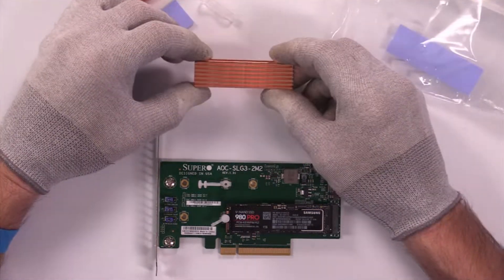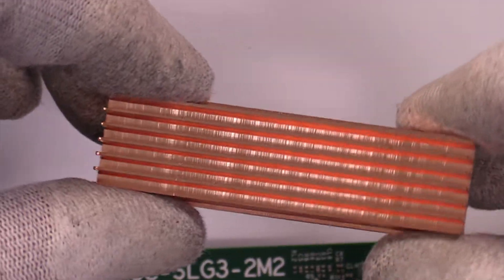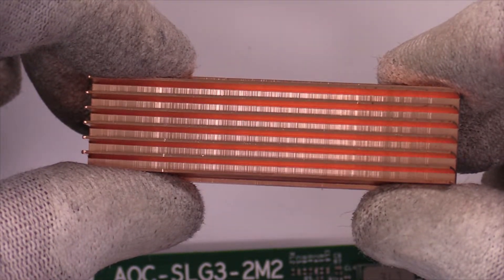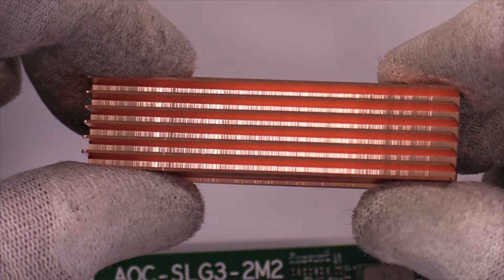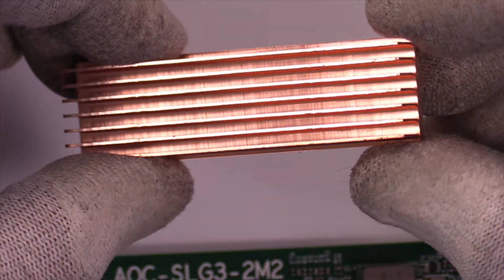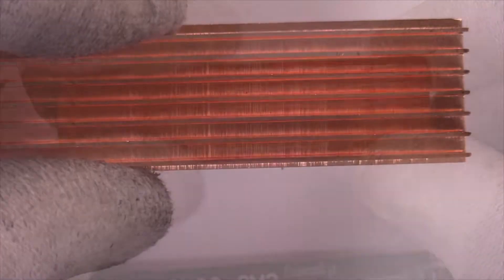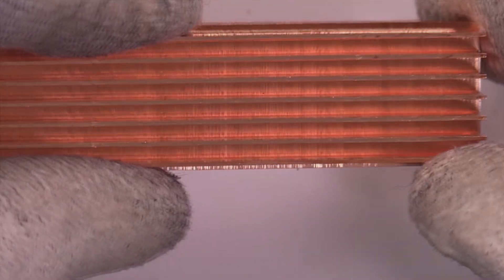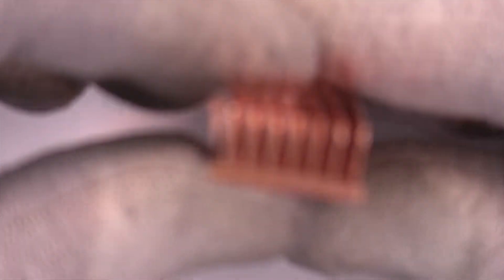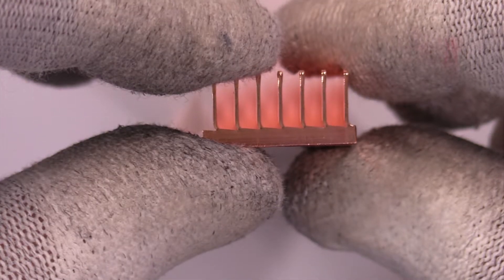These are extrusions — or so I first thought. But if you look down through there, there's some machining to that. I don't think that's an extrusion. That's machined. I expected an extrusion where all they had to do was cut lengths. No — that is bar stock. You can see the marks. They're taking bar stock and machining it. Copper is about twice as effective as aluminum.